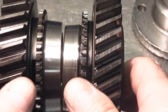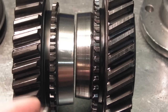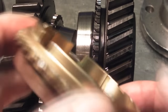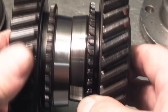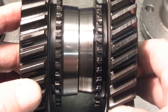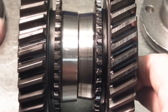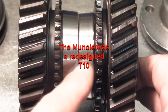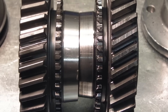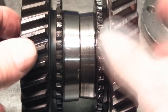On my right is the T10 gear, on the left is the Muncie gear. If you compare a Muncie ring to a T10 ring, they have the same identical outside diameter — 36 teeth. People always ask why does the Muncie shift better than the T10. It's the cone. When GM redesigned the T10, they put larger cones — the cone on the Muncie gear is slightly larger than the T10 gear. They did this because when they beefed the T10 up with larger gears and more mass, the engineers felt they needed more braking power on the cone to stop it due to the greater inertia of the heavier gear train. So they made the ring cones bigger — both rings look the same, but the Muncie cone is bigger than the T10 cone.